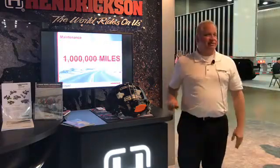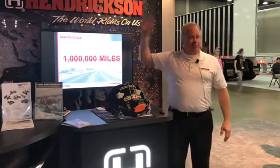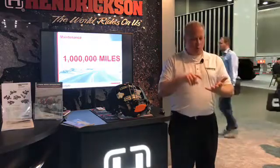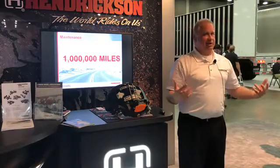The second most important thing to remember: you'll hear people tell you that you'll get a certain number of miles on your brake. You'll never hear people experienced with all the different applications say that. It's dependent upon where you're running, what you're carrying, what style of application you've got, what your driver is like, what your tractor unit is like, what the valving is like, whether it's a driver that tends to use the handbrake. All of those things come into play. So what we typically say is: use the same maintenance intervals you used for your drum brake to look at the disc brake and make sure everything is still running okay.